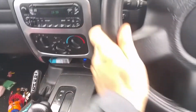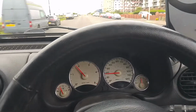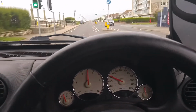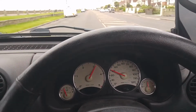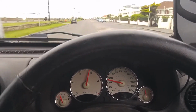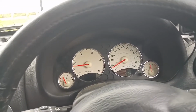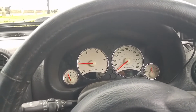So we put it down into first. Got first. Into second. And then if I put it into drive, this happens. Nothing at all. Still got reverse, and like I said, still got first.